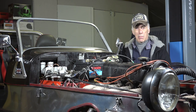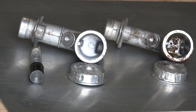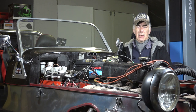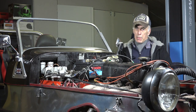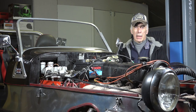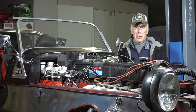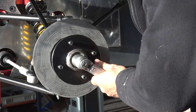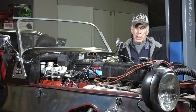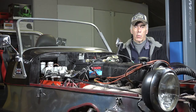Because the brake pipe runs over that panel, now is the right time since all the brake pipes will be disconnected. We'll do a short inspection of the differential, put the cover back, and fill it up with oil. Once that's done, we'll check the two main brake cylinders — one for the front wheels, one for the rear. We'll inspect, clean, and test them, then flush the brake pipes with fresh brake fluid. When all that's okay, we'll reinstall the front suspension system, wheel hubs, uprights, and brake calipers, hook up new brake hoses, and bleed the brake system.